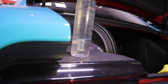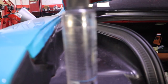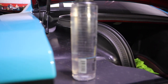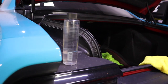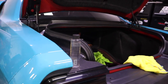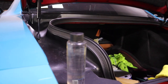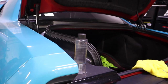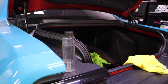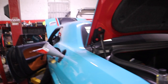E85 in the winter time — most companies miss this, but do you see that line of separation? Right there — it's right at E80, and a little short on top, so that might be E81. To have E81 at the pump in the winter time — this gas station is the truth. They are so consistent with the ethanol; there have been times the ethanol content was E87. You literally have to buy race gas E85 to get that level of consistency. The station is Power in East Orange, New Jersey — always great ethanol.